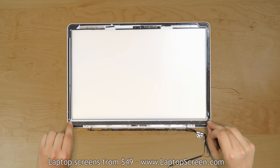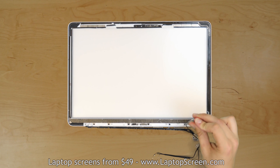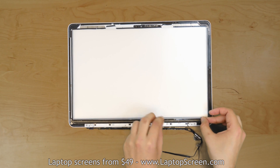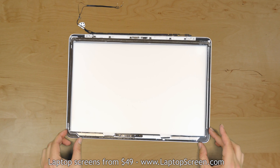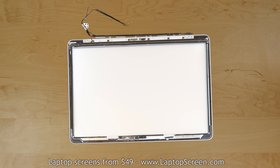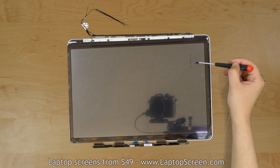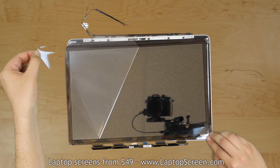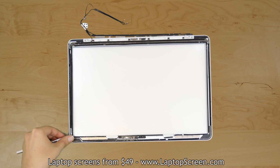Replace the metal display guide and secure it with eight Phillips screws. Apply two strips of adhesive to the guide. Since you only get one shot at gluing the LCD matrix back in place, it's best to rehearse that action before you expose the adhesive strips. For an easier installation, it's best to position the assembly's top edge towards yourself. Please note, there is protective film applied to the back of the LCD matrix and sometimes numbers can be printed on it. The protective film must be removed immediately before gluing the LCD matrix back into the display assembly. Protect the back surface of the LCD matrix against scratches and dust once the film has been removed. Go ahead and expose all of the adhesive strips and blast the diffusers off with compressed air before installing the new LCD matrix.